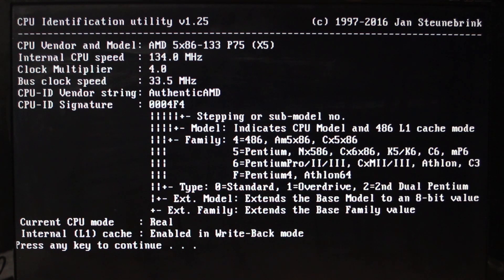What did work was to set it up as an Intel write-back enhanced 486DX2/66, also known as the P24D, and then go hunting for the clock multiplier pin which also breaks out on the jumpers. Once I put a jumper on there, everything worked perfectly.